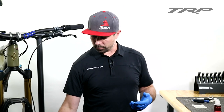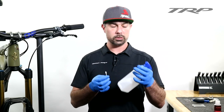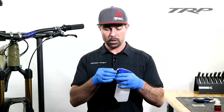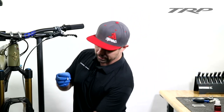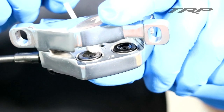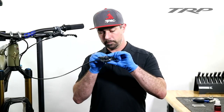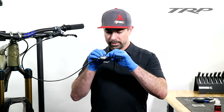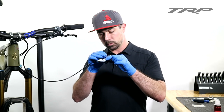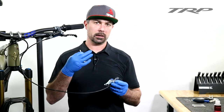I've already removed the caliper from the bike and removed the brake pads to get to these pistons. The next step is to clean it — we want to remove any dirt and grime that might be in there so that it doesn't get trapped between the piston and the seal. Using your isopropyl alcohol and a cotton swab, wet the tip of the cotton swab and start to clean the inside of the caliper. Make sure to get all the nooks and crannies, and definitely get 360 degrees around each piston. You may go through a few swabs to get it adequately clean.